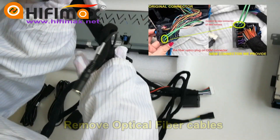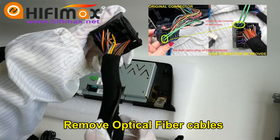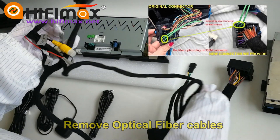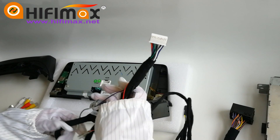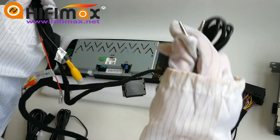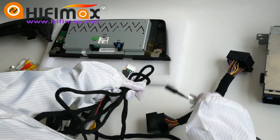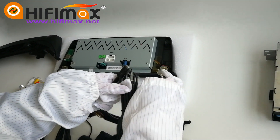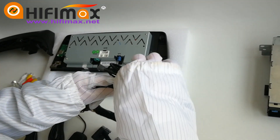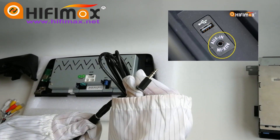If you have optical fiber in the car, you have to move to this host so the sound can come out. To make the sound come out, you need to connect the audio — the AUX cable — to transfer the audio. You can find the audio out port from the power cable. Connect this with this port, and this AUX port goes to the original AUX in the car.